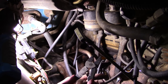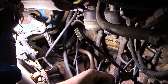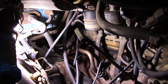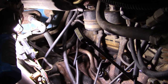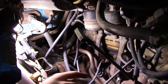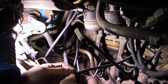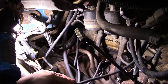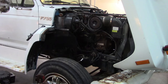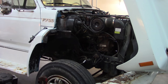I can't get the right spark plug wires until tomorrow and I don't have any old ones laying around. I do have a new set of spark plug wires from a point-style ignition - I might be able to MacGyver this together for testing purposes. We'll just wrap the wires around each other and tuck this out of the way. Well, it's running a lot better, but now it won't idle down at all. It's stuck at about 1500 RPM.